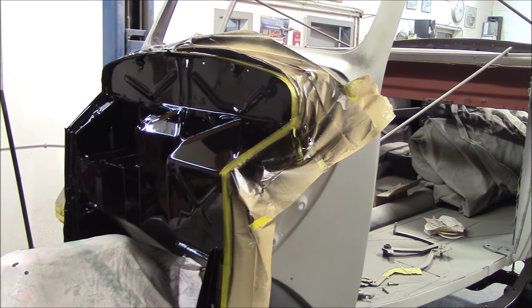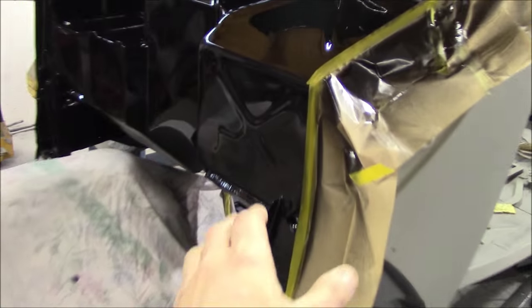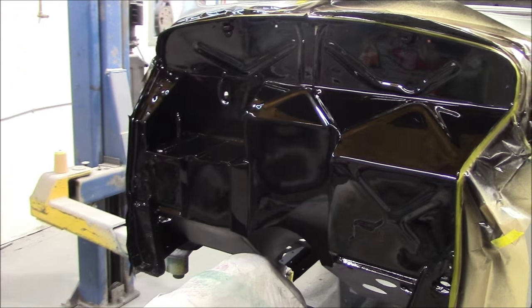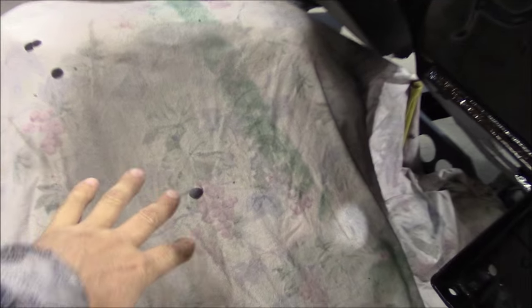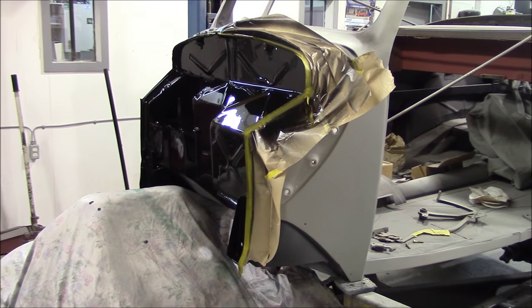Believe it or not, when you bolt a body down, it does change the gaps, and if you think about it, if you tighten the body a little tighter in the front than the back, it's going to open the gaps up here and there. So Dan just wanted to do the firewall shiny black, so Dave sprayed her last night. This we were able to spray in the shop. He sprayed her shiny black. That way, because the motor underneath this towel, a blanket, is in there. It's just done, it's over with. We don't have to try and get in there and paint and do anything.